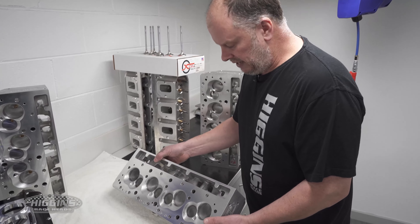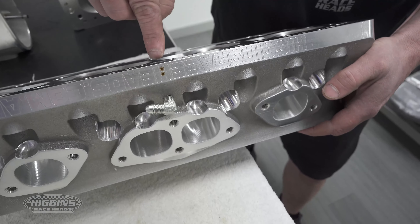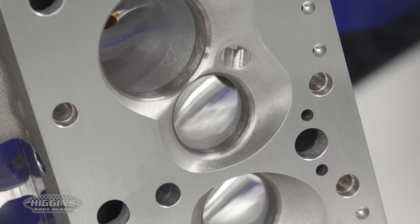Some of the things with our cylinder heads that we offer — standard, we have the water going through the two exhaust ports up at the top here. We've got two holes in through here intersected from down here. This one here obviously comes from the water pump to feed cold water straight into between the exhaust ports.